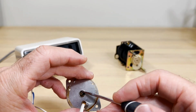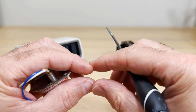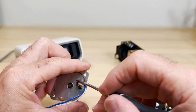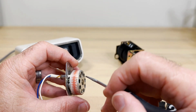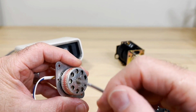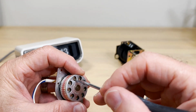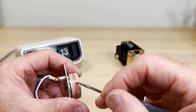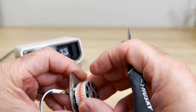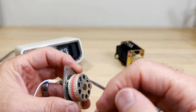It's called an oil-impregnated brass bushing, and it's usually made out of brass shavings that have been compressed. Now, you can compress them, and it's hard, and you can't really break it easily, but it'll still have spaces in it, and they impregnate that with oil. So that oil-impregnated brass bushing will keep this clock going for years and years. Now, that'll get used up over time and dry out. So by dropping oil down there, you're hoping to hit that, let it get through there, and re-oil that bearing. So it's more properly called a bushing, and you can call it a bearing if you want to. So that's why you do it.